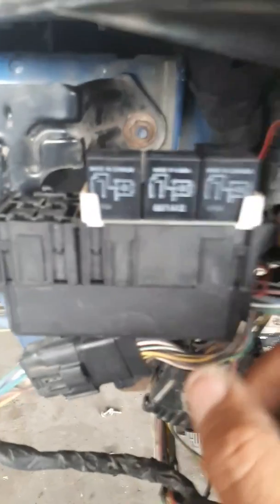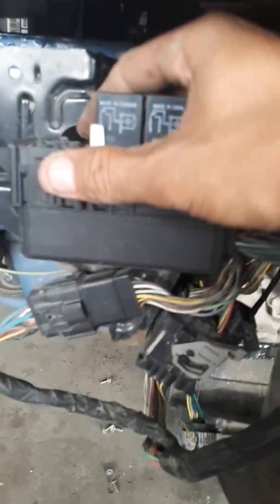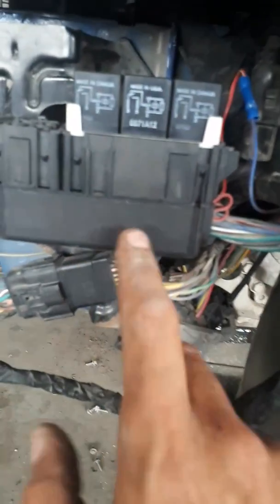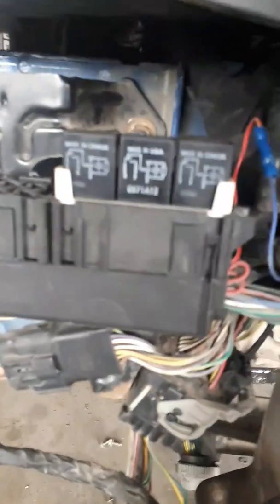What I had to do was take this all apart. I pulled this off — there are two bolts, one there and one under there. I took the clips off; there are two little clips in the back that you push on and this whole thing slides off. You can take that top white piece off and pull the bottom piece out — there are two little clips you just pull out on each side, one, two. On the other side you have to stick a screwdriver in them to get them out.